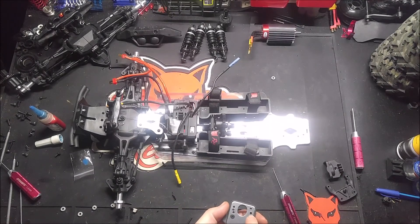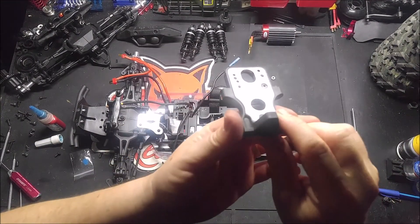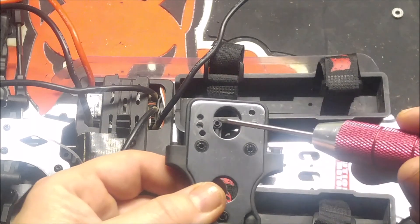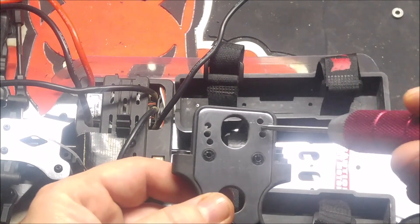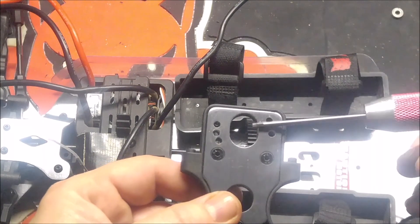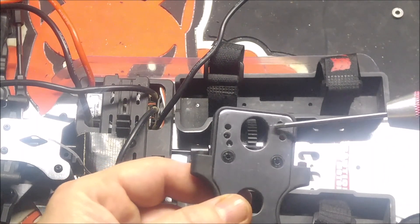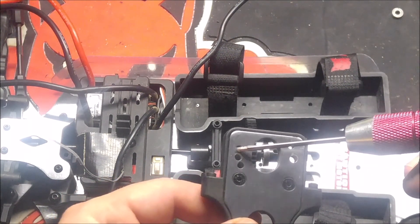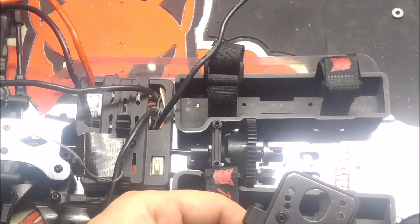It's going off the wire — I never really looked to see where I unplugged it. It looks like it's these two for the motor, but I'm curious as to what these are. I'm thinking it's for a bigger motor. This one mounts up here, which would be pushing it further up off of that platform that sits here. So I'm thinking that might be for a bigger motor, because you would put it here on one end and then you could either angle it here or here, depending on if you were going with probably a 40 can versus a 42 can. So I might just try it out just to see what it looks like.